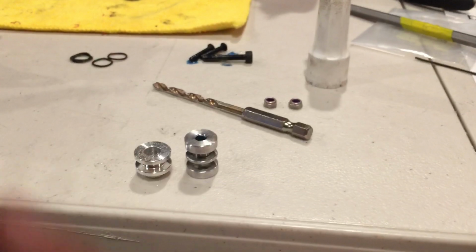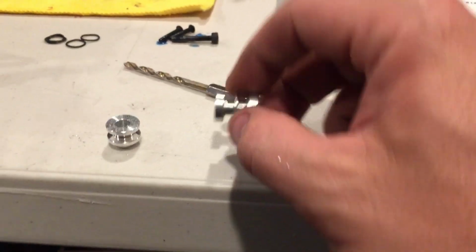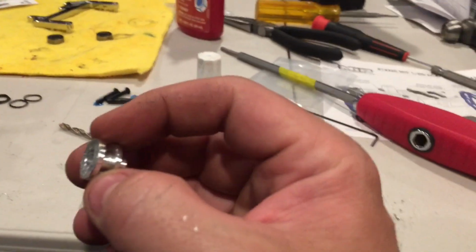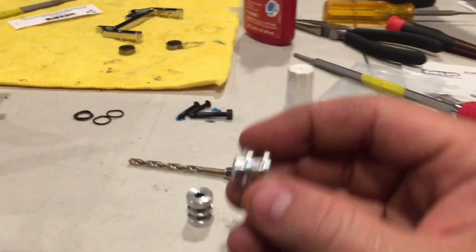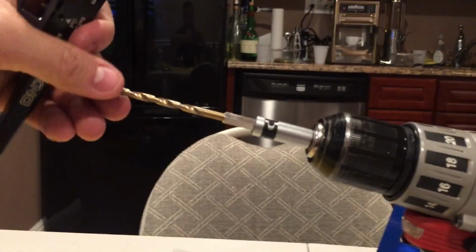Okay, here's the Modified RC one. I guess this is if you want to run 4 brakes, 4 discs. You can fit the rotor here and here, but they're not right. I was gonna use this, and I don't care about the extension, but it's slightly off. So I want to make sure I have the correct size. I want to make sure it's shimmed correctly, so that this rotor does not wear out this piece here. Premature wear, you know. This is what keeps your rotor in line, in space. So as you can see, I use this bit here.